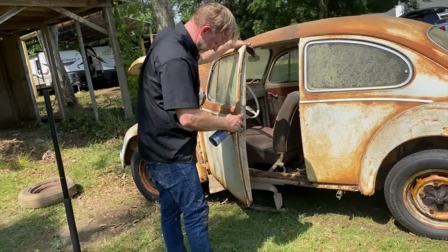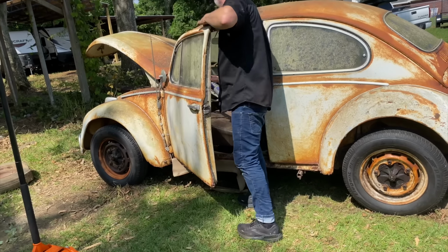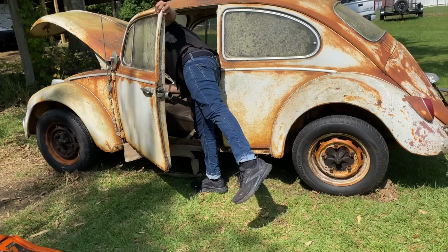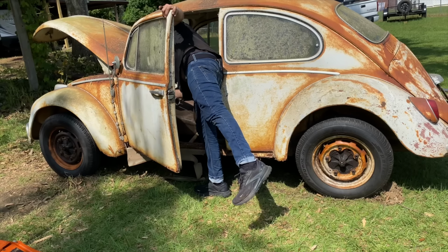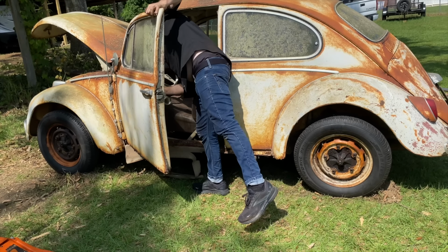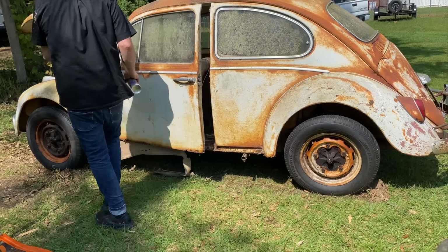And I took the frame off and scooted it back toward the wheels about two foot, which left a long frame up front. And then I put a V8 Chevrolet motor in it, automatic transmission. I built a homemade bed for the back of it, and put a Lincoln grill in it and a set of crutches to hold the grill struts up.